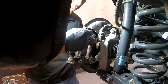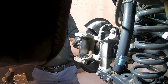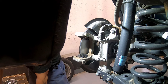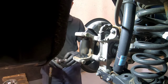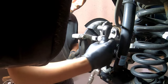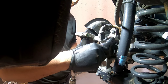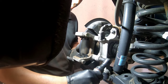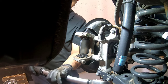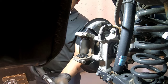We are going to install this bracket in the knuckle area. Here we go. And then we are going to torque them — the torque spec is 59 to 79, so we're going to torque to 65 foot-pounds.